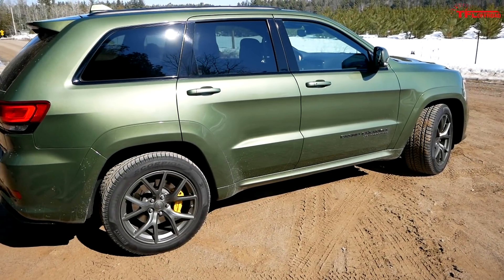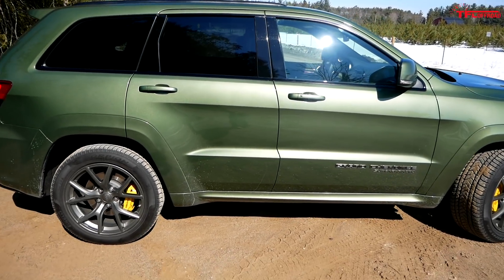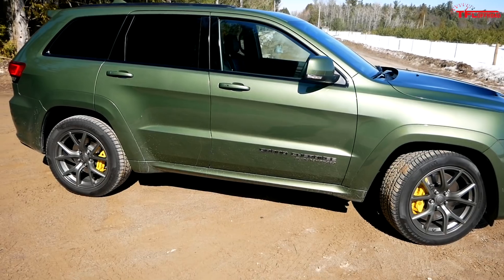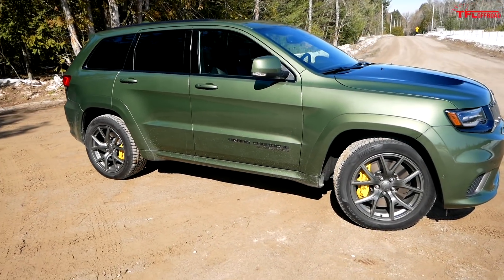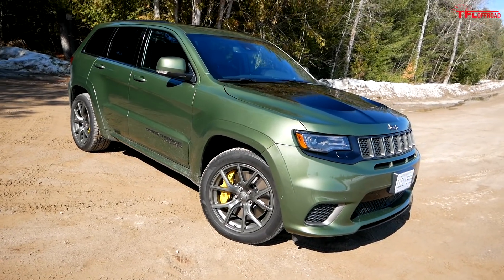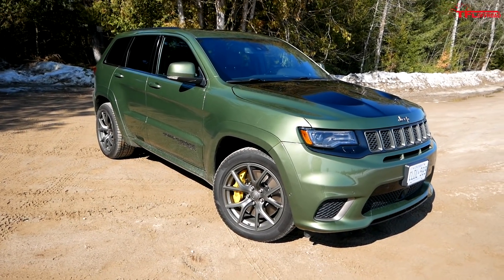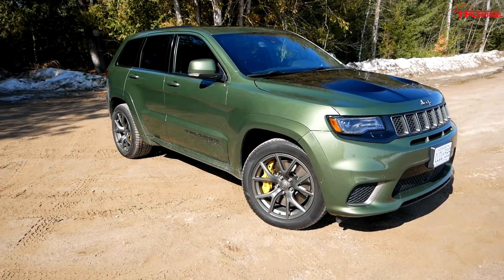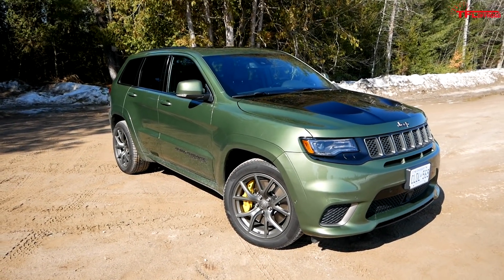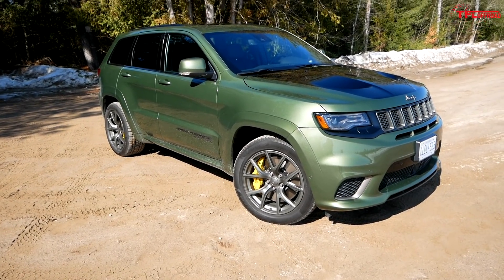What's interesting is the way this Grand Cherokee splits power. In auto mode you get a 40-60 front-to-rear split. In snow mode you get a perfect 50-50. In tow/haul mode it goes 60-40. In sport mode it's basically rear-wheel drive at 35-65. And then track mode goes 30-70. So this thing really can split where it is sending the power, making it more formidable in the snow and even better when you're actually racing with it.